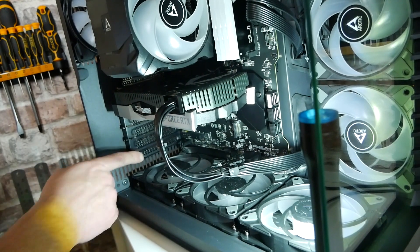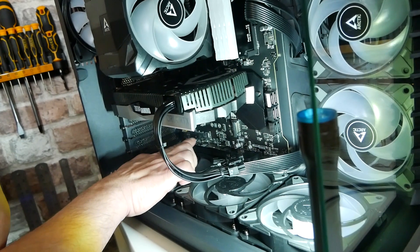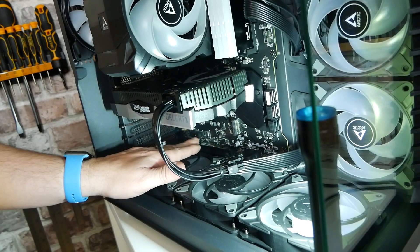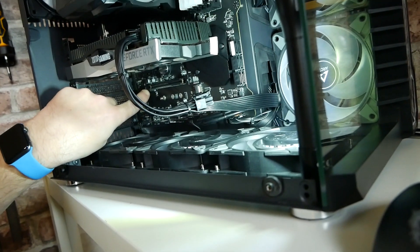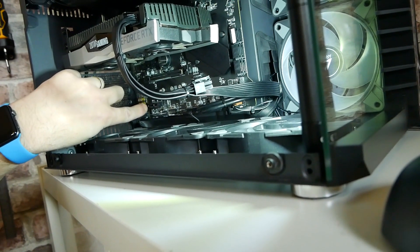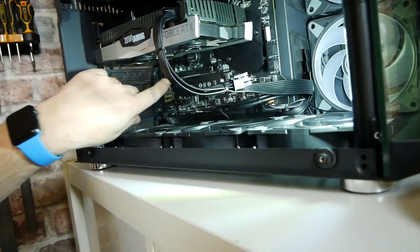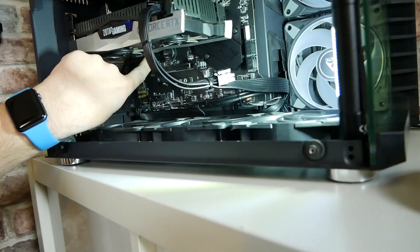The first thing we need to do is remove a suitable PCI Express blanking plate from the back section. If you look at your available PCI Express ports, you can use a x1 slot, which is what we've got here at the bottom. But you can also use a full-length x16 slot — it will also work. So whether you've got a x16, x4, x8, or x1 slot, you can use it, but ideally try and use one which is not in use and away from the graphics card, as it might be a little bit tight for the fans.